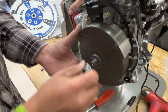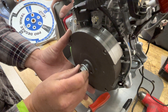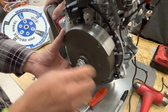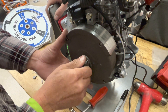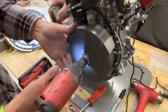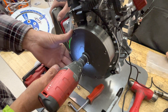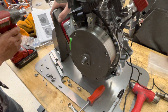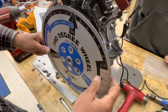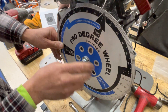So if you know nothing and you just want to advance the timing, you could loosen that nut, jerk the flywheel forward and tighten it back up and you're advanced. You'd have to pop the flywheel off though. All right, that was a three degree key. So we were just under 25 — we'll see if we're just under 28 now.